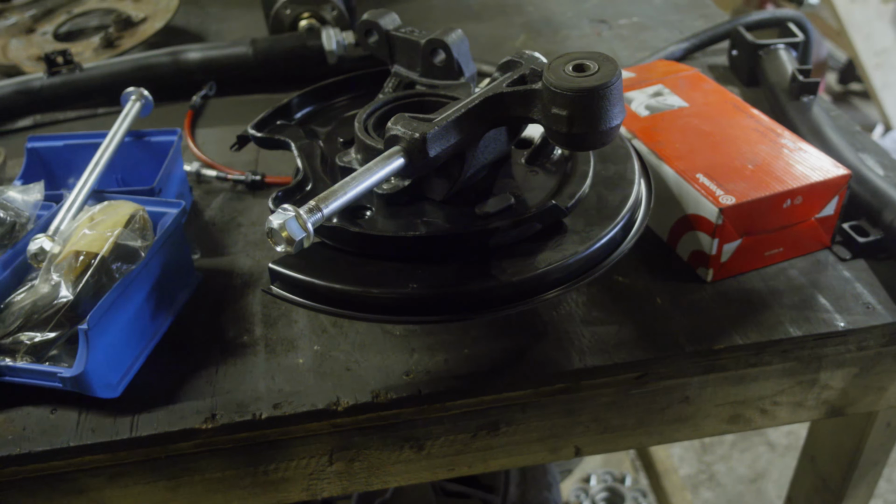I don't know how to begin this sentence. So there was putting bolts where bolts are supposed to be, wanting to assemble the brake as far as I can. I noticed I was missing the rubber seal for the lower brake adjustment for the parking brake. So I just thought, well, the old ones look good, I'm gonna take the ones from the old one. Wouldn't it be a scary coincidence if the old parts wouldn't be the same, and I just wouldn't have noticed all the time? They aren't the same.